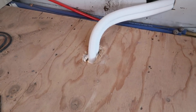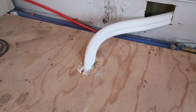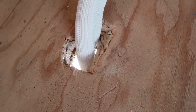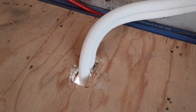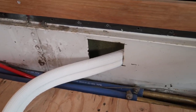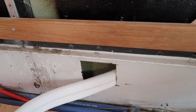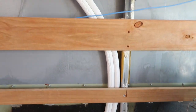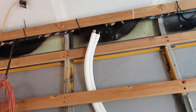These are the copper pipes run down through the floor. This will be under the couch that I'm installing. I will foam — you can see that there's some space in there. These copper pipes have nice foam insulation around them but I will foam all inside these holes to stabilize it, keep it from moving. I will also foam around the pipe itself to stabilize it so that there's no movement when we're going down the road. I'll foam the hole where it goes through as well. And I actually did a serpentine here so that I have room to manipulate it at the top.